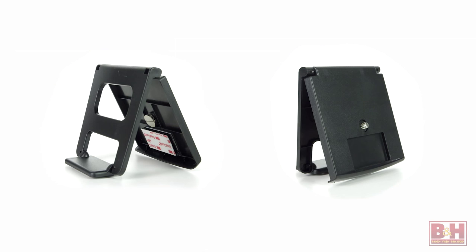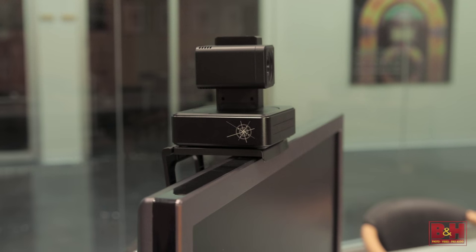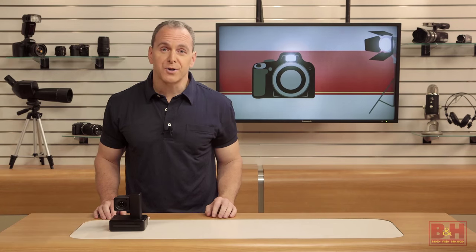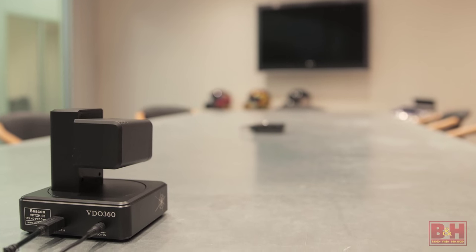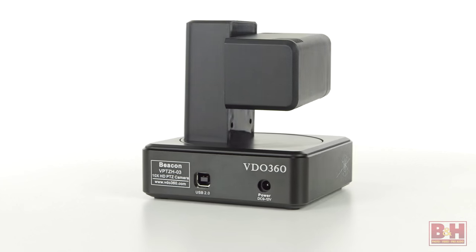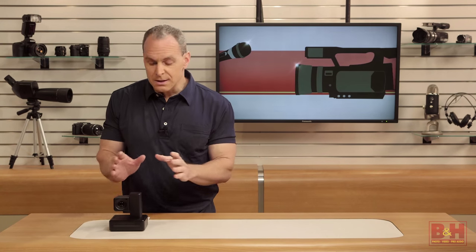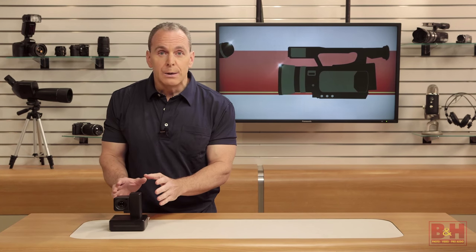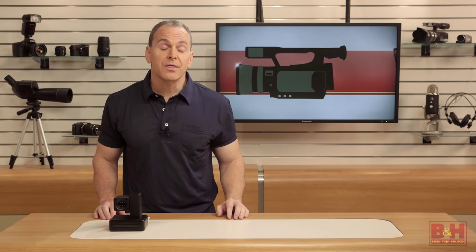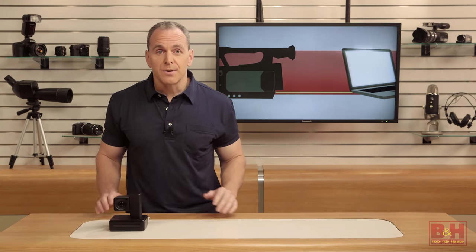It has a mount you can use to attach the camera to a monitor, but that mount relies on 3M Dual Lock reclosable fasteners, so you're trusting tape to hold a camera that weighs about a pound. You can buy an optional wall or monitor mount. I would use it either on a desktop or on a tripod using the quarter-20 mount. It has a USB 2.0 output — why not USB 3.0? Video 360 says that because this is a native USB camera, USB 2.0 has plenty of bandwidth to give you 1080p high definition at 30 frames a second, and I did not notice any video glitches or quality problems that you'd see from a slow data transfer.